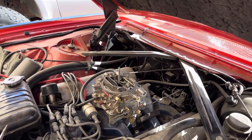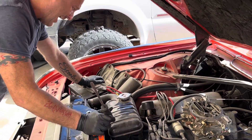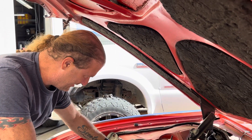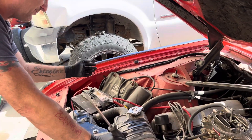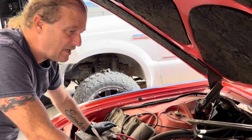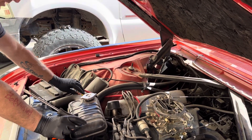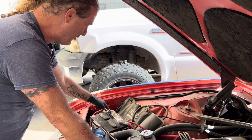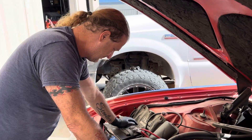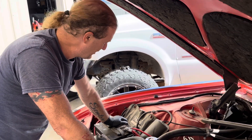There'll be an updated invoice for Van with this video. The recommendation is to replace the red battery cable with a black one. It's unclear why every cable on this car is red. The concern is that if someone else ever works on it, they might accidentally reverse polarity — something that happens a lot especially on Fords, which are wired backwards compared to most cars.